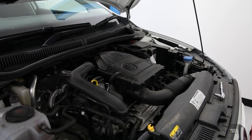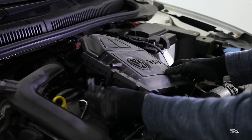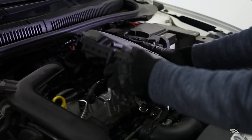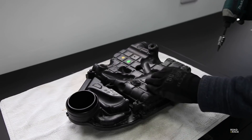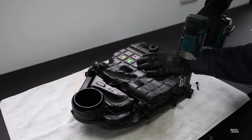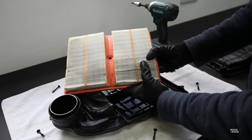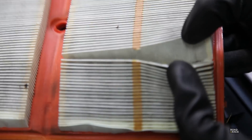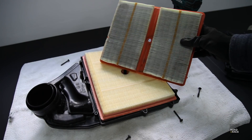Having been used to cars with air filters that are very quick and easy to change, I was slightly surprised at how fiddly VW make it. You have to remove a hose, then another hose, then a screw, then the whole air box lifts out and you have to turn it upside down and take out about eight different screws. Here's the existing air filter — it doesn't look too dirty really, but I've got the new one and it's nice and clean. Here they are side by side, so it makes sense to just change it out.